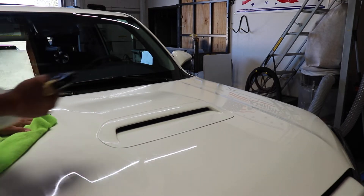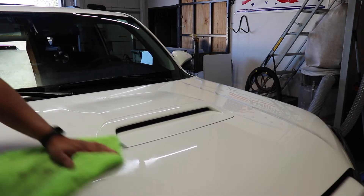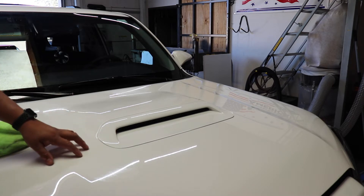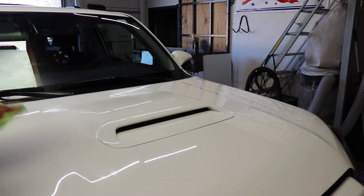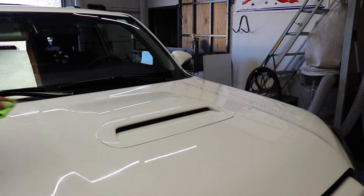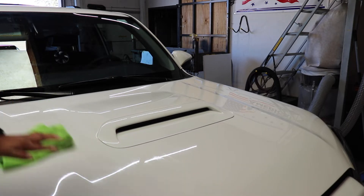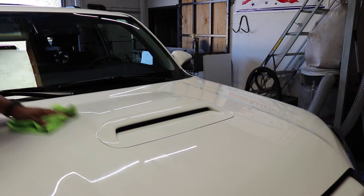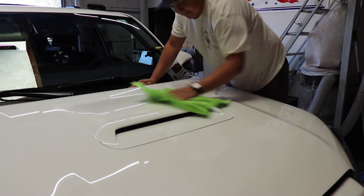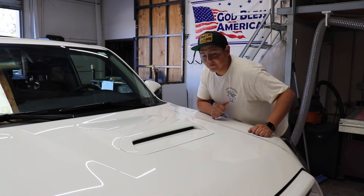You can get it at Walmart or wherever you guys have locally — just put it in a spray bottle, spray and wipe it down. This gets rid of any oils and debris and creates a nice clean surface to work from. The last thing you want is for oils to stay on your hood while you're wrapping it because that prevents the vinyl from grabbing onto the surface. Even though you're only wrapping the upper section, you want to make sure to clean all around the hood so that you have the cleanest surface possible.